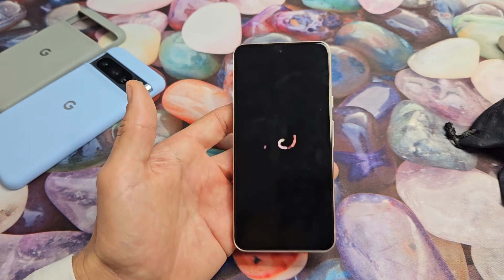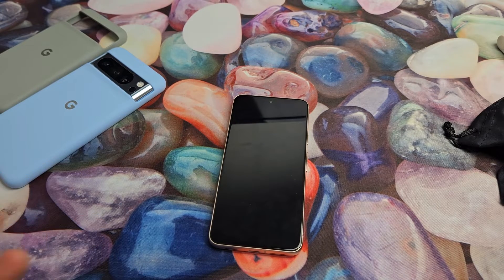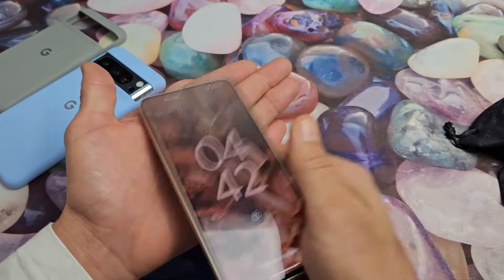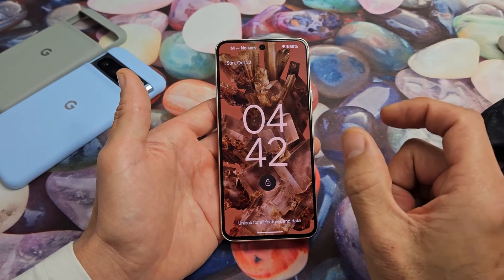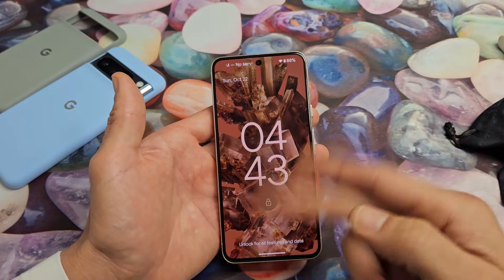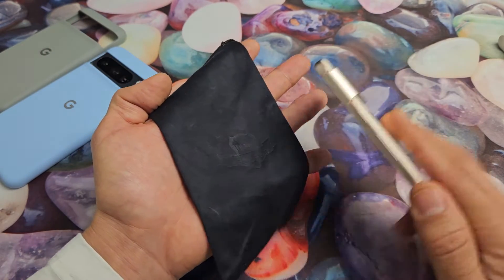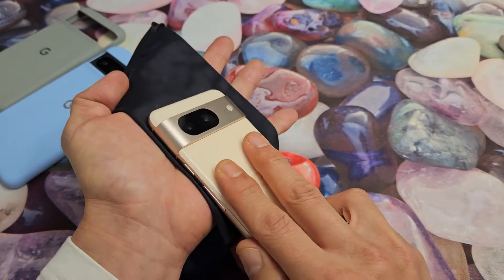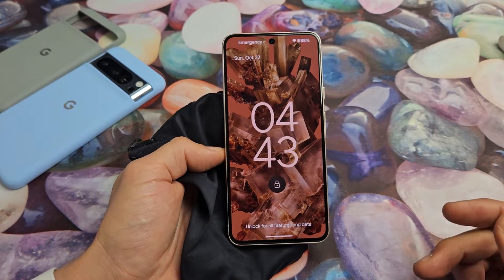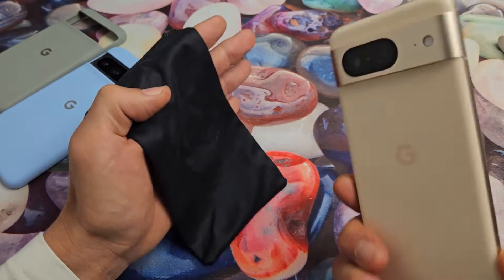I see the Google logo — wait for it to boot up, and hopefully you are out of the black screen now. If not, don't worry, we're going to go to the next possible step. So your screen is still black — no problem. The next step is what I call the smack method. Grab your phone like this, put your palm out. I want you to smack all over on the screen and all over on the back. The same premise as the tapping method — you may have a ribbon cable that's slightly disconnected and a little smack, believe it or not, can pop it into place. If you don't want to smudge up your screen, you can hold a cloth there. Smack it kind of hard on the top of the screen and also on the bottom. Give it a couple of whacks, turn the phone over, tap that power button, and see if your screen is on.